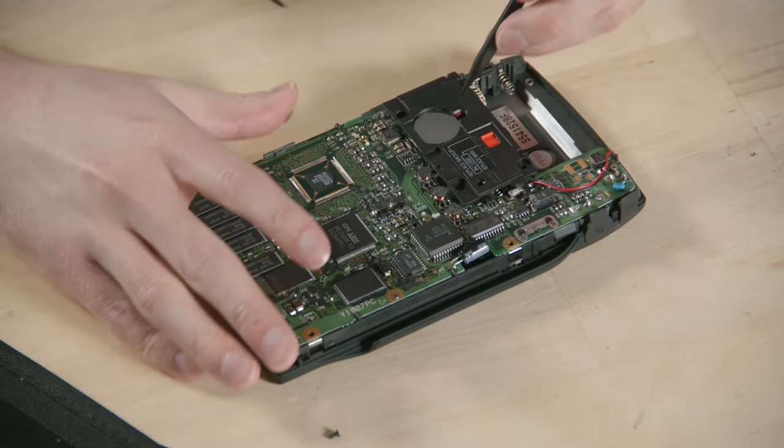Like I mentioned in my 8-Bit Guy collab episode, capacitors will die when they want to die, and when they're 28 years old, yeah, they're probably gonna die. So this guy right here needs to be replaced, most likely to get the video circuitry working. This guy probably doesn't need to be replaced, but we could replace him anyway. And there's another one for the sound as well.